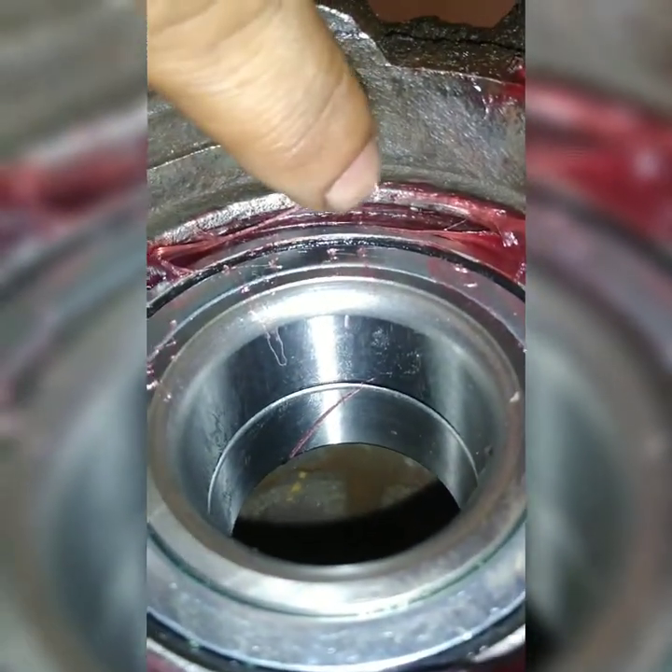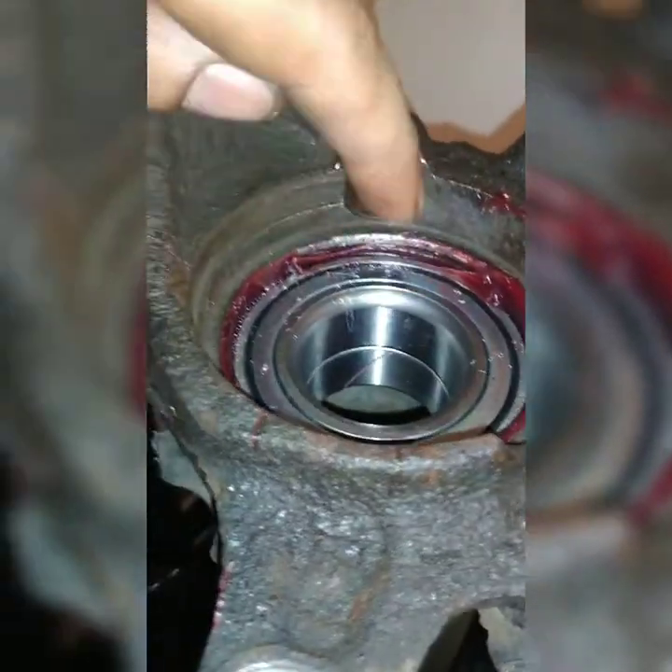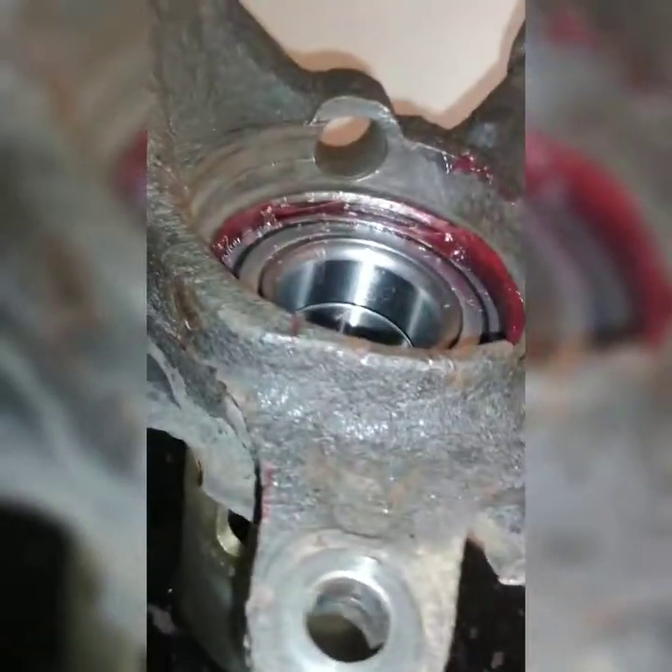I think I do see grease caking up there — I'm hoping it's all the way in. I'm going to zoom in just to make sure. I did a test, took out a dab of grease, and I can clearly see my snap ring groove. Everything's caked out on the front, so once I take off that caking it should be perfectly flush. I'm going to clean off that snap ring groove, put my snap ring on with the grease for a permanent seal, then take the excess off and proceed with the hub.